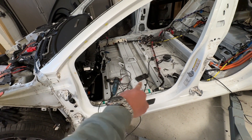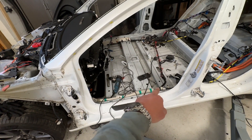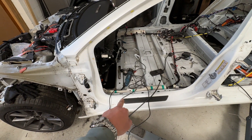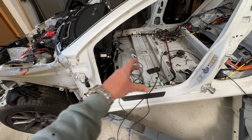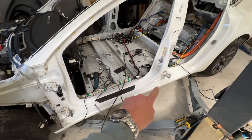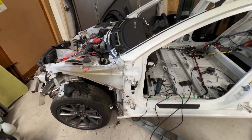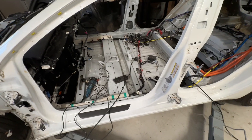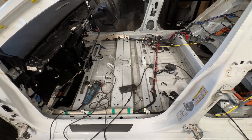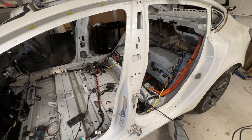I'll probably cut that centre thicker one out — it's near enough 475mm between those rails. But it doesn't quite line up with where the battery mounts are, so the floor is going to be staggered from the main beams. Before I do that chop I'll take the outer skin off. Lots more wiring disconnected, just going to be bundled up in the front footwells for the cut.